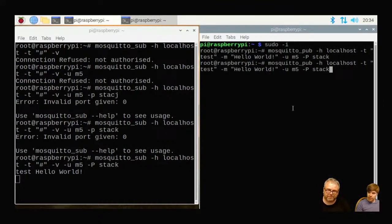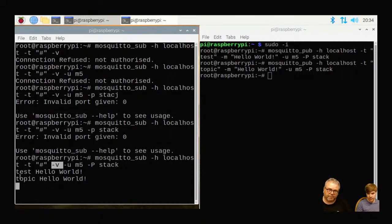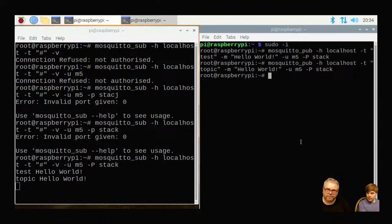So we could change the topic to topic. And then on the left we should see topic and then hello world. Because we have the V flag on the subscribe, it is also showing the topic. But you could also omit that and you would just see hello world and nothing else. So that is the installation of a basic MQTT server, which is just running on this Pi.